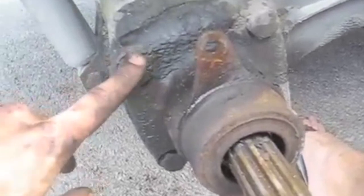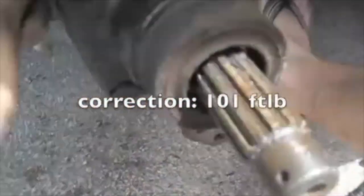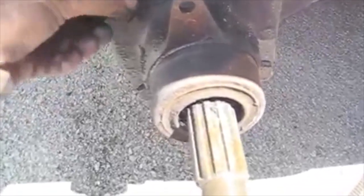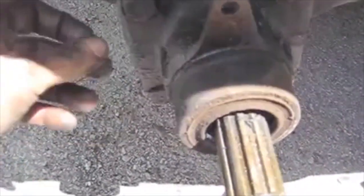The next thing is to take off these four bolts. They're tightened to 131 foot-pounds and they are 22 millimeters. When I did that, it pretty well screwed up those 17 millimeter bolts — I'm probably going to have to find new ones. On both sides these came off real nice and smooth, but when I put the first side back together and then took it apart again, it did not feel like it took 131 foot-pounds to get it off, so I'm going to put some Loctite on there when I put them back on.